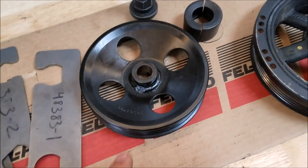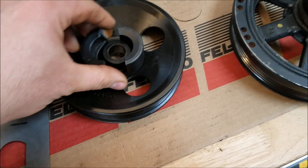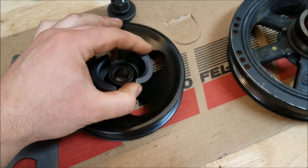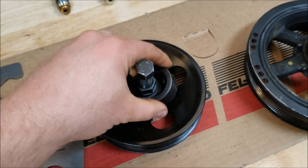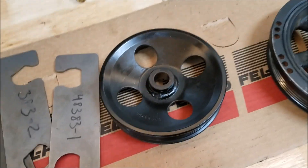As far as the power steering pulley goes, you're going to need a special tool to remove it. This is a very simple, reasonably priced tool. It just goes on here like this, and the puller goes inside. You tighten up the nut and it'll slowly pull off the power steering pulley, so you can unbolt it from the vehicle and put it off to the side.